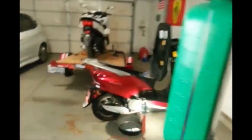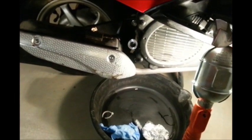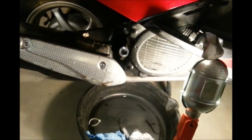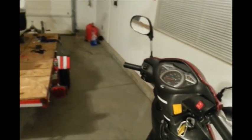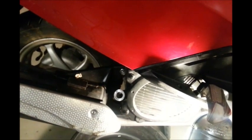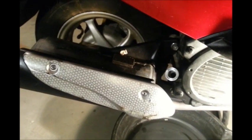I kept riding. About half a quart was left. 20 to 30 miles later the bike started losing power — bogging down, especially at high RPM. Then the temperature gauge started going up and hit almost three-quarters. I shut down the engine and stopped. I restarted it in two minutes and surprisingly the gauge was back to under half the heat range. I don't think it overheated, and I made it back home, but it had lost most of its power and was really struggling. Let's see what the oil level is right now and we'll go from there.